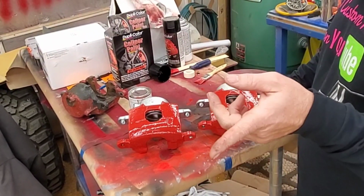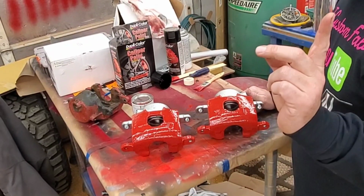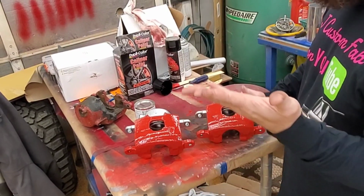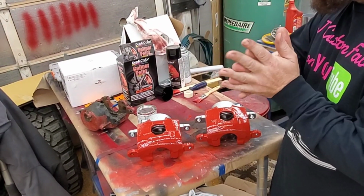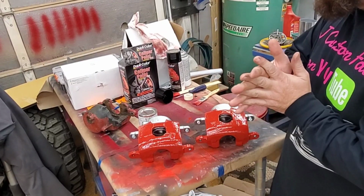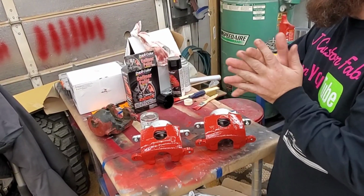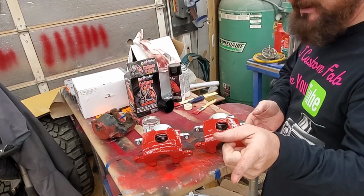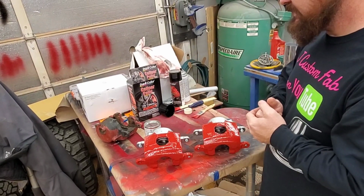I'm waiting on one thing, the starter motor. I'm waiting for a new one to come. The one I had burned up when I was cranking it for some weird reason. It was the original LS starter motor. It must not have enough oomph for the compression on the motor. So I got a new one coming. I hope it'll be here tomorrow because I'm going out of town.